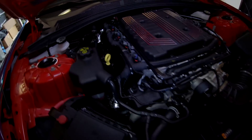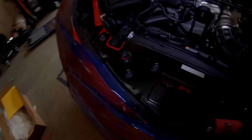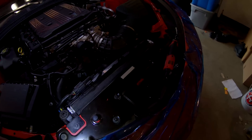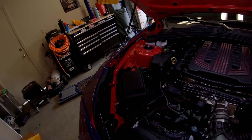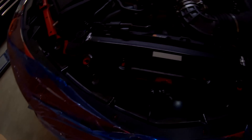Got everything installed - the final assembly looks really clean, especially on the LT4/LT1. It highlights and brings attention to the actual engine with small subtle details. Now for the radiator cover: it's pretty straightforward. You'll need T15 torx tips, T30 torx tips, a 10mm, 13mm, and some needle nose pliers. I already started removing the associated hardware to get the factory rad cover off. Next we're going to disconnect the hood latch - mark or tape it so you know where it goes - then slide the cover off.